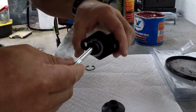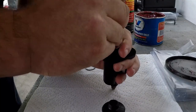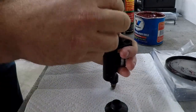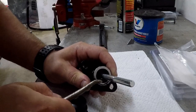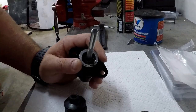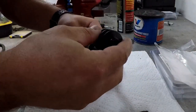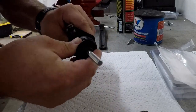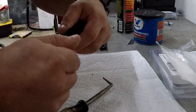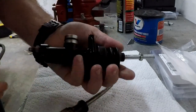The little pusher rod goes in and the snap ring goes on top of the washer. You have to compress the whole thing so you can get the washer behind where the snap ring goes — but if you're like me and only have two hands, this is a bit of a struggle; three hands would make it much easier. Then slide the boot on and struggle to get it over the cylinder case. Last piece of the puzzle: slide the locking nut back on, and it's done.